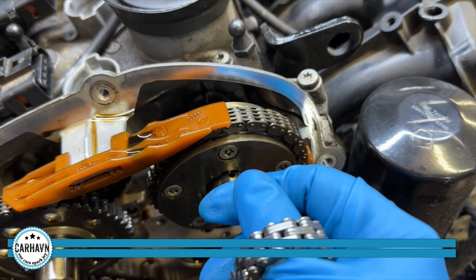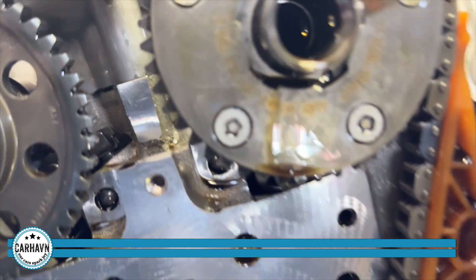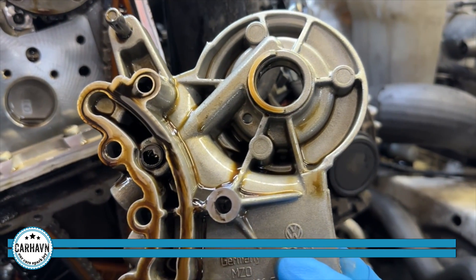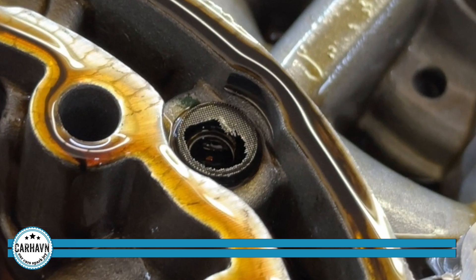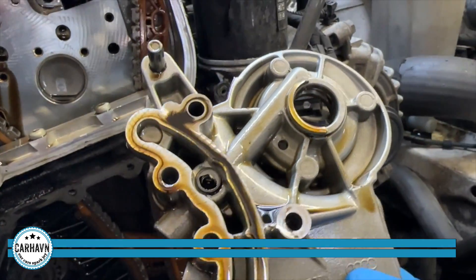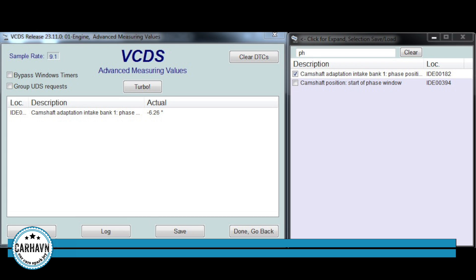All the guides get changed, the chain itself gets changed, and all the other components from the kit. The other important thing is the camshaft bridge — this always happens: the little screen in there is completely destroyed, which allows oil to flow through at much higher pressure than it was designed for, causing problems in the variable timing system. This piece gets changed with the improved Dorman part, which has a laser-engraved mesh versus the original which is just welded.